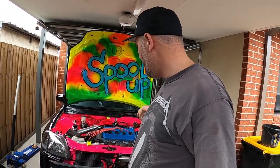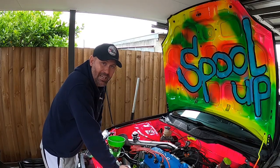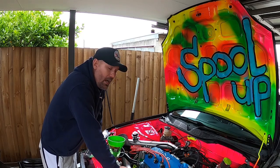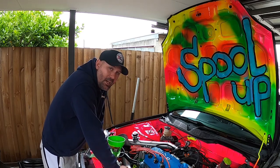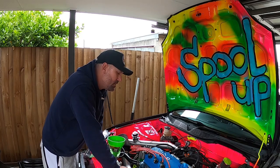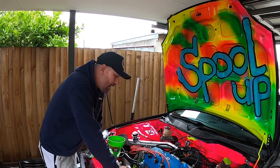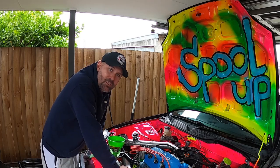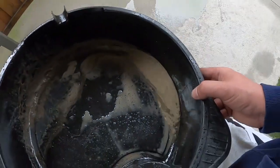I'm going to do a compression check and test the engine now that it's had about 300K's on it. All four cylinders are perfectly equal and even - compression is at 170 PSI. When I did this without driving the car, just after having it running for five to ten minutes, it was at 160. It's gone up 10 PSI. I don't know if it's going to go up more - this is the first engine I've ever built.